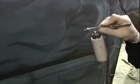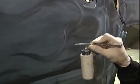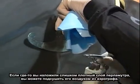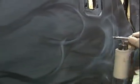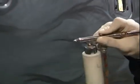You're sketching out the flames. If you have rough, straggling lines, don't worry about that. It's okay. This is just a rough draft. Most of that will be covered up. Another thing you can do, if you think you're laying down your pearl a little bit too heavy in one spot, you can use the air from the airbrush to help it dry out a little bit before you move on any further. You don't want to drag that pearl down. It's a hard mistake to fix.